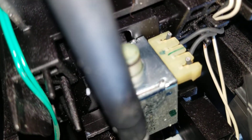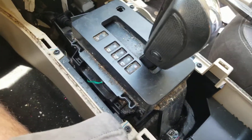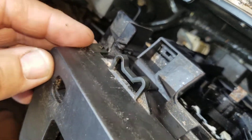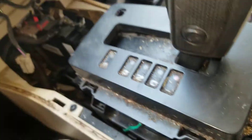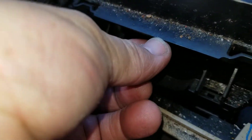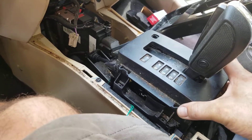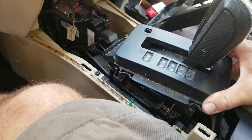We're trying to get to that shift cable. If you look in there, you'll see that the end of it goes up in there. So you're going to get in here and start popping these little clips loose so you can get it off. Everybody's loose and you're wondering what's going on — it won't come loose. Well, you've got this light bulb right here, and you turn it like that and that comes out. Because you're not taking the gear shift off, you're only going to get some slack. You turn this thing 90 degrees.